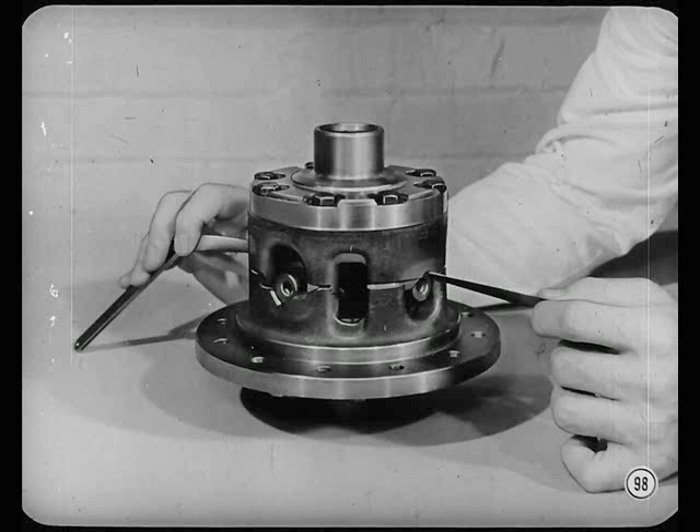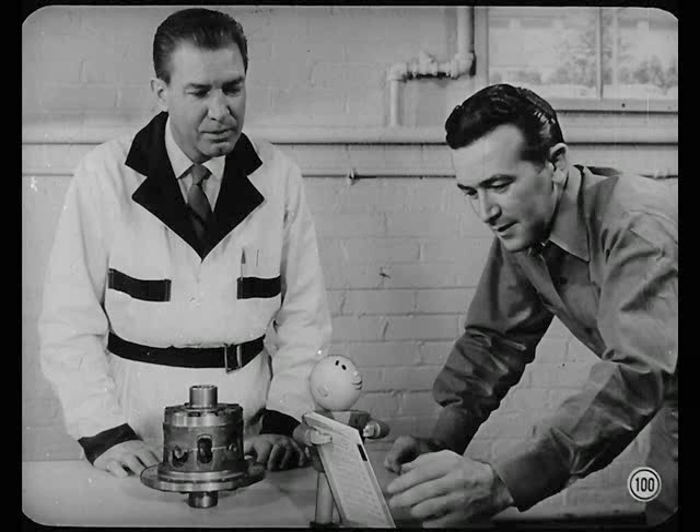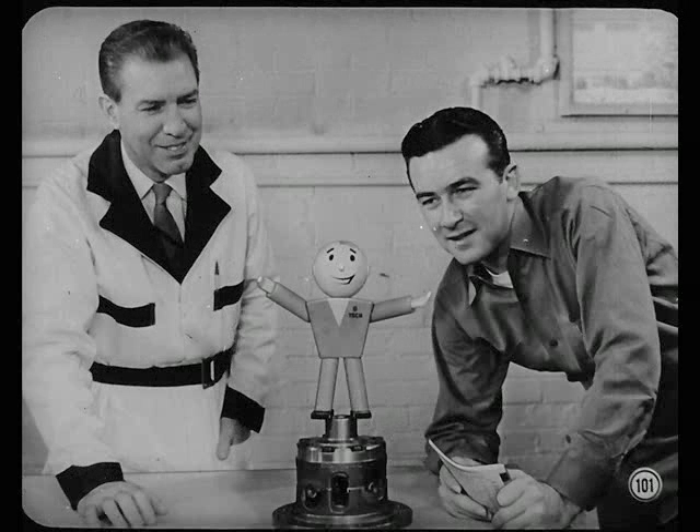Any other suggestions? Don't spin the rear wheel when it's up on a jack unless you block the other wheel — otherwise the clutches might engage and move the car off the jack. There is some more Sure Grip information in the reference book, like tips on assembly. Give that book a careful reading. Now, why don't you and all of your technicians take a closer look at this new Sure Grip Differential? Try some of these checks today and get ready to give it your top flight attention.